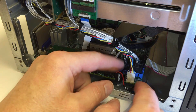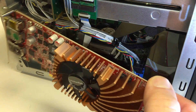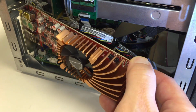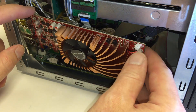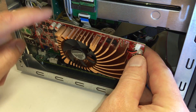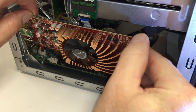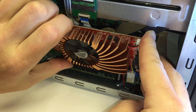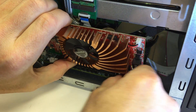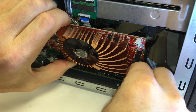We've got the speaker header out of the way, and we've got the GPU where we want to — carefully making sure this doesn't scratch any wire traces on the motherboard — gently putting it where it belongs. Don't bother to clear the backplane yet for the drives; you've got to line up the bottom of the slot first. So at this point we're just lining up the bottom of the slot, and now that that's in, we can go ahead and reattach the speaker header.